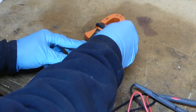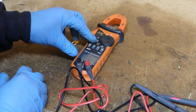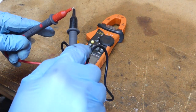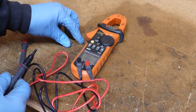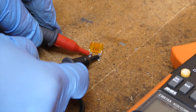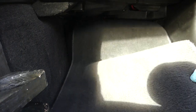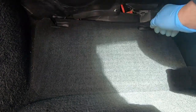To start out we're going to get the multimeter out and check the ohms on the fuses. This new multimeter is pretty nice — it actually makes a sound when things are good, but otherwise you just want to check your fuse to make sure it zeroes out and you have a good fuse. We'll do it in the actual fuse box itself. Go to your passenger side, pull out your floor mat, then remove that panel to get to the fuse box.